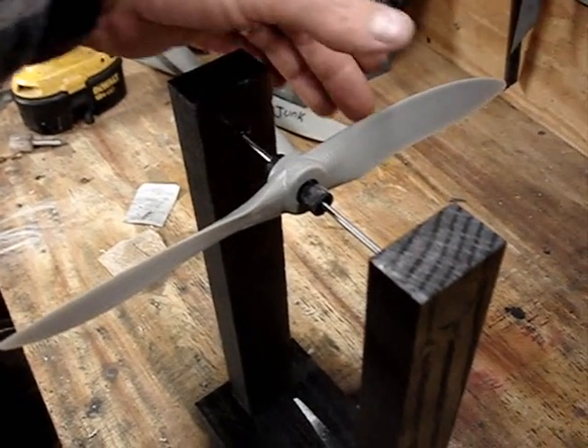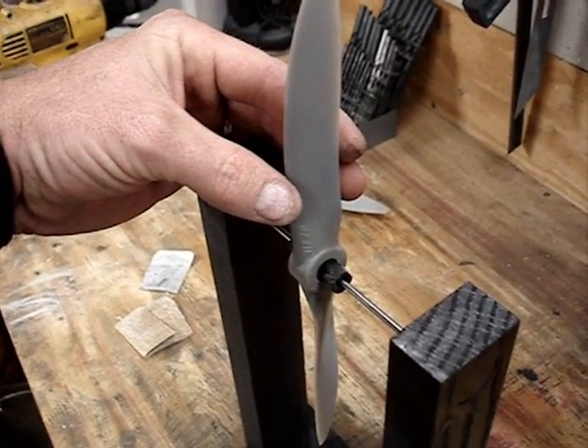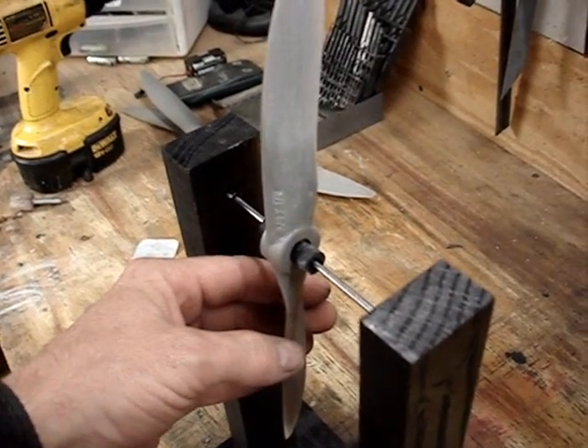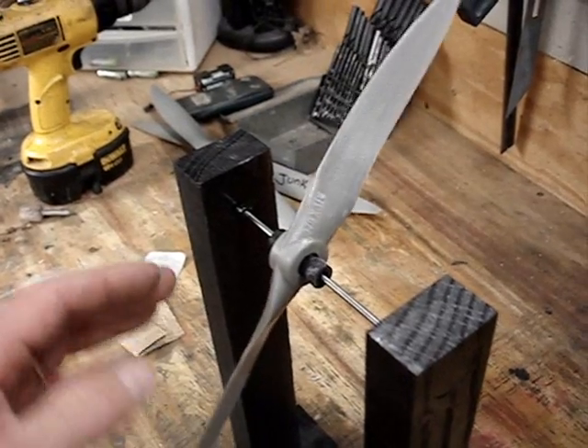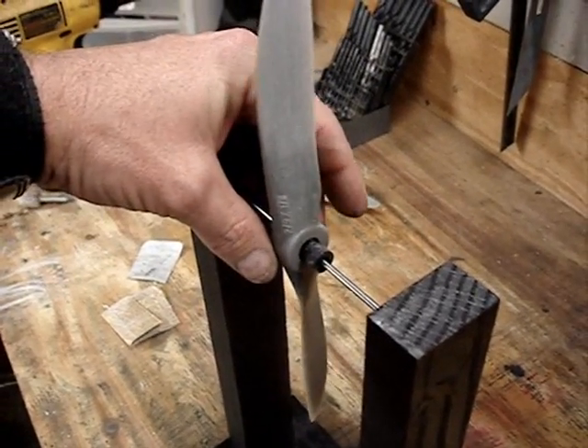But we're not. Put it straight up and down, and it falls. Notice the direction — put it straight up and down and it falls. Notice the direction. That tells me this side of the hub is unbalanced.